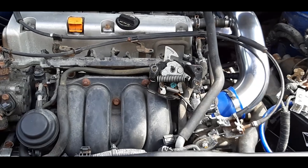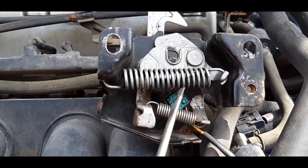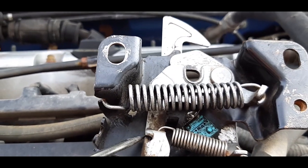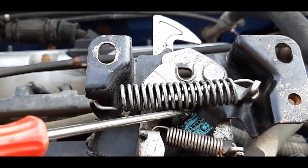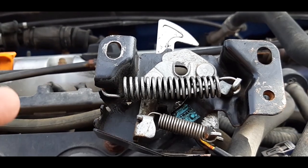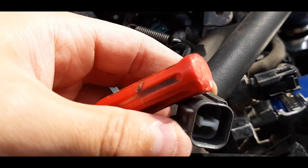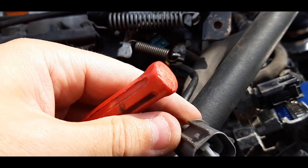I've already gone ahead and ordered the part through Acura — I'll leave the part number and description for you. Here's my old unit for the hood latch. One little tip here: this little box is responsible for letting the car know the hood is actually closed. My little spring there was bent a little when I tried cleaning it, and it was causing my alarm to go off.